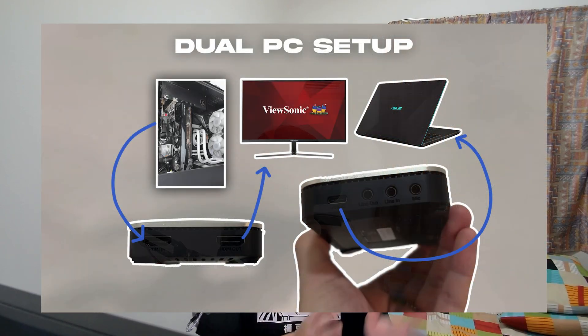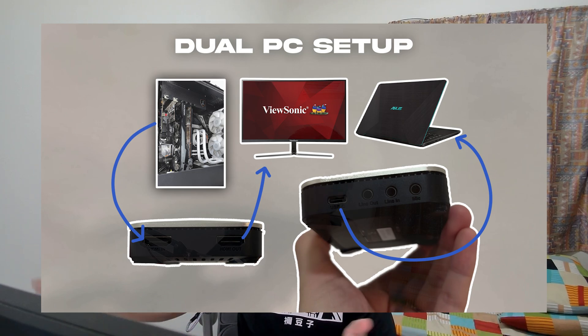Now let's talk about the setup. Basically, the HDMI goes from my PC to the capture card, then from the capture card it goes to the monitor via pass-through, and the USB-C goes into my laptop, which is my capturing device. I open OBS, add a video capture card source, and you're good to go. Everything you see on your main monitor is also seen by the capture card with no added FPS impact. One thing to note: if I don't have the capture card powered via the laptop's USB, I also won't be able to see anything on my monitor — but that's how most capture cards work unless you do some extra power configuration.